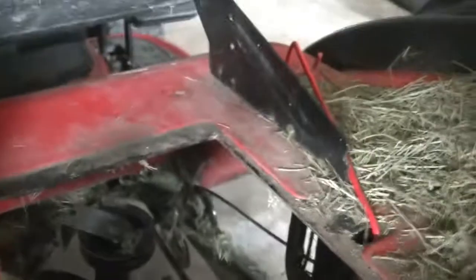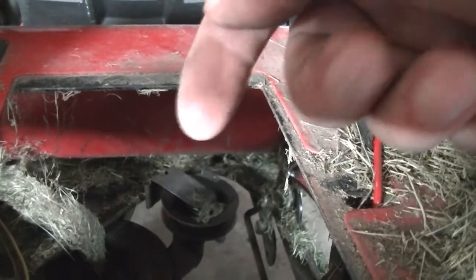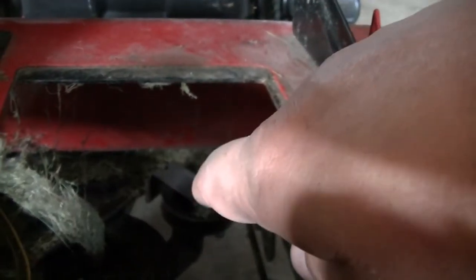Now, regarding this third pulley, it was very easy. Actually, I found that there is a spot on that side. So I moved my hand inside from here. Difficult to show from that spot, and then I was able to pull this pulley a little bit outside so that the belt comes out, and it came out easily. So there was no need to remove any spring or anything, nothing to open on this pulley. Only I removed the nut on this one pulley.